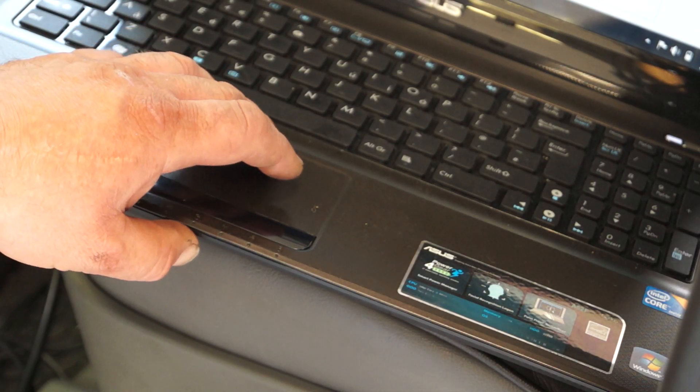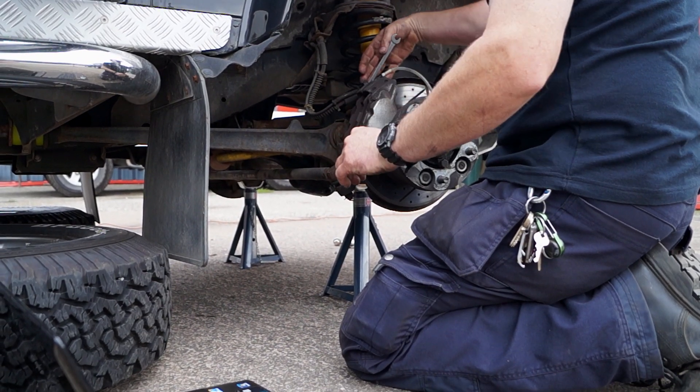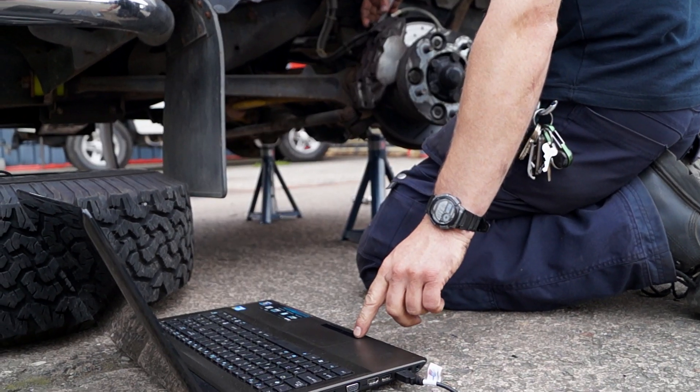Confirm okay. Once that's done — second cycle completed — another cycle? I'm going to go for no. We've now completed the modulator bleed process. The next step is a power bleed, following the instructions: front left wheel power bleed. This is the first point of bleeding on the system, and the starting position is different depending on the vehicle you have.